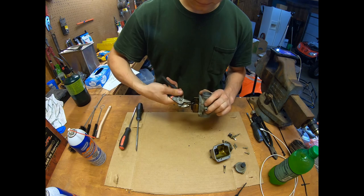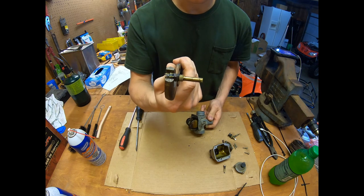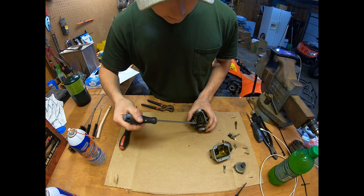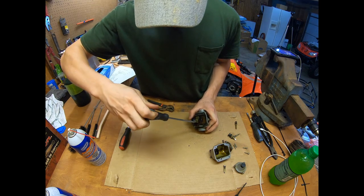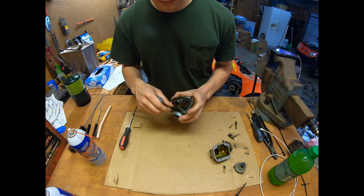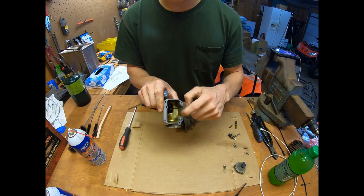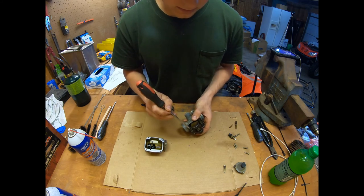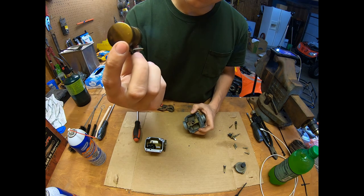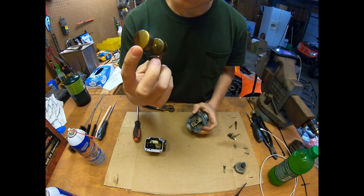There's also an o-ring on the main jet. Now I'll take out the pilot jet with a straight-blade screwdriver. Next, take out the float — there's a flat on one side. The rod that goes through there is captured in the carburetor body so it can't come all the way out. I'll push it out with a screwdriver, grab it and set it aside. The float comes out with the float needle too. The needle does not look bad at all — surprisingly, this one does not appear to be rubber-tipped.